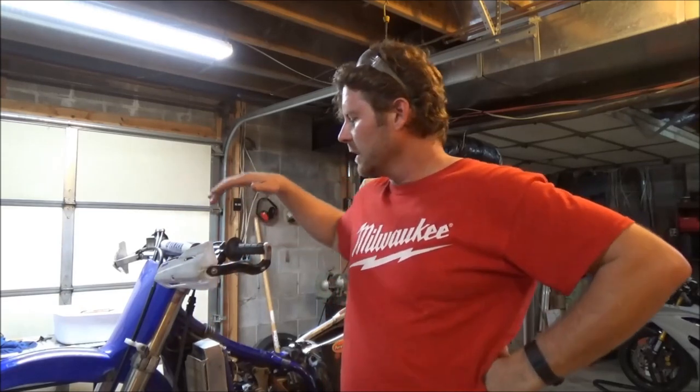Kick it to top dead center, then pull the lever, kick it a couple times and that procedure works pretty good. Well, this is a 2001 but it has the 2003 decompression cam in it. What we know about a decomp cam is you should be able to just freaking whirl that thing and it should fire right up. That wasn't happening for me last night.